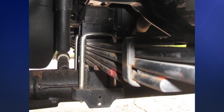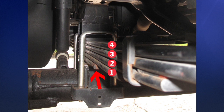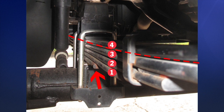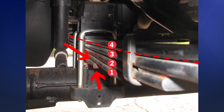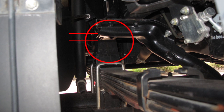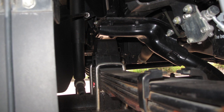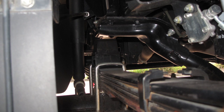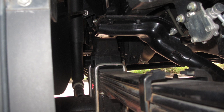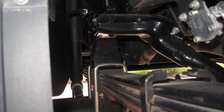First let's have a look at what the original suspension make-up is, starting at the front. The front has a four-leaf primary pack plus one secondary support leaf. This spring pack design is obviously struggling under the vehicle's current loaded weight, as it is looking relatively flat and the four primary leaves are laying down permanently in contact with the second stage leaf. Note also how close the bump stop is to the chassis, which means the two will come into contact quite soon when articulating over uneven surfaces or bumps. This original design incorporates the compression of this bump stop as part of the suspension when the spring works hard. The spring will then reverse or bend backwards and unfortunately will return to its normal camber position quite quickly once the load comes off.